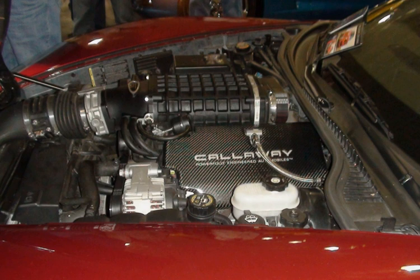The LSX will be available starting the second quarter of 2007, set to be available in authorized dealerships and retailers on March 31, 2007. The Hennessey Venom GT uses an LSX engine based on the LS7. Chevrolet Performance LSX bowtie block features include: LSX-specific six bolts per cylinder head bolt pattern, billet steel six-bolt dowel-located main bearing caps, extra thick deck for maximum clamping force, extra thick cylinder walls allowing maximum 4.2 in (106.7 mm) bore with 0.2 in (5.1 mm) minimum wall thickness, true priority main oiling system, and main web bay-to-bay breathing holes. A 396 cu in (6.5L) version is used in NASCAR for the Gander Outdoors Truck Series and ARCA Racing Series as an option engine.